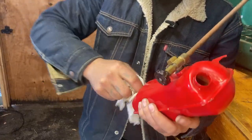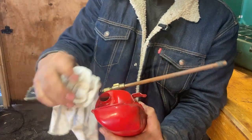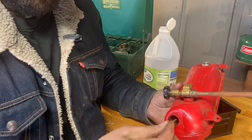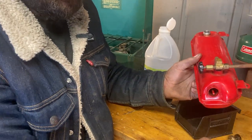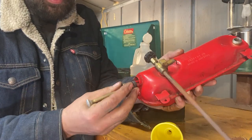Now I'm going to wipe all this vinegar off the tank and put humpty dumpty back together again. First we have our valve stem - put that in here, feel it out, don't cross-thread it. This is screwing into the top of our check valve. When you pump these things up and loosen it, you're loosening that stem. We'll put our pump back in.